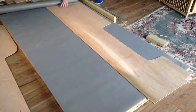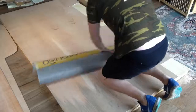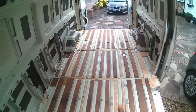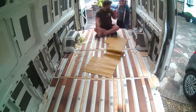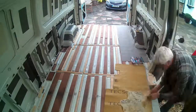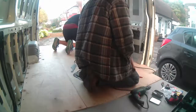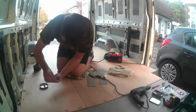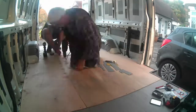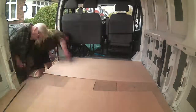This Tech Sound was my answer for acoustic and minimal thermal insulation — the heavy, thick, rubbery mat with just a carpet on one side. Install that over the top of the 9mm strips. Trying to take the plastic backing off — I don't know if you're meant to, but it was a bloody nightmare to get off, so I'm not sure if it was worth it. There was also a step where I laid out the ply flooring, drew on the top surface with a pen to mark where the wooden battens were, drilled a load of pilot holes, and then went around and countersunk every single hole, screwing it all into the wooden battens rather than into the metal of the van.